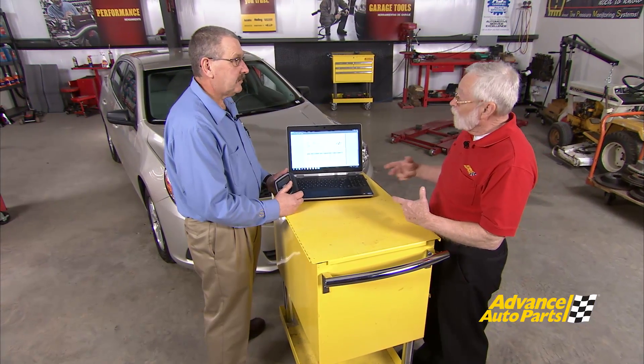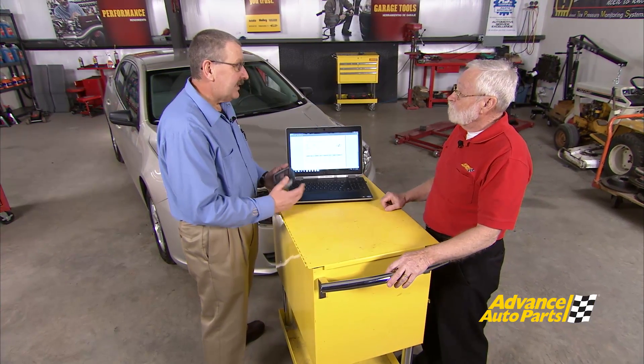In this particular Malibu, I go to where I see the picture of the tires on the dash, then hold the set/clear button on the end of the turn signal lever. It asks if I want to relearn the tires — I arrow up to yes, press the button again, and the horn honks telling me I'm ready to do the relearn. The tool at the same time tells me to go to left front, and we go around just like we did on the test before you touch. Step six is really about documentation. The audit report after the relearn limits our liability — with this report in our records, we know everything was correct when the vehicle left the shop.